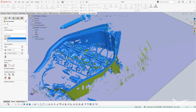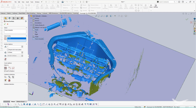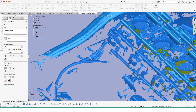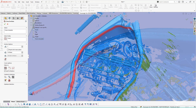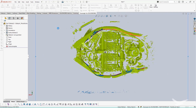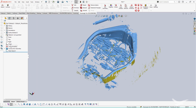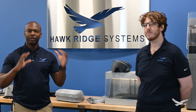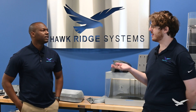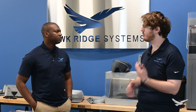We created reference bodies inside SolidWorks from the scan data. We got the interior of the frame so we knew how large the airbox could be. We got the actual carburetors — the mounting points and geometry. We also got the area under the frame where the radiator goes, so we knew exactly how to route the RAM air tube without interfering with other components like the cylinder, valve cover, or throttle cables. We reverse engineered a lot of those components to have reference data to build the airbox and RAM air. One of the big things was not wanting to move any cables.